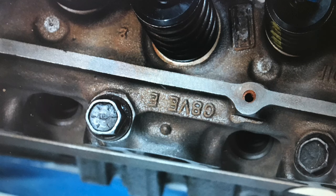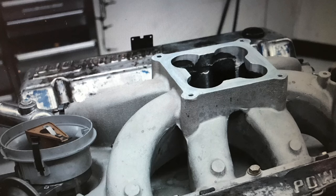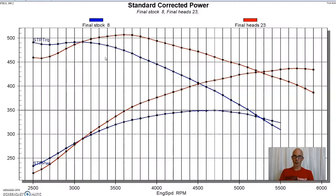I said, yep. They said, okay, I'll give you our 460 cylinder head porting and our 460 600 horsepower head and cam package, basically. And all you have to do is take that head and camshaft, put it on that 460, and especially if you've got a flat top piston, if you put a good single plane intake manifold on it, it will make 600. And if these guys tell you that it will make 600, it will actually make 600. So what we did was we took them at their word.